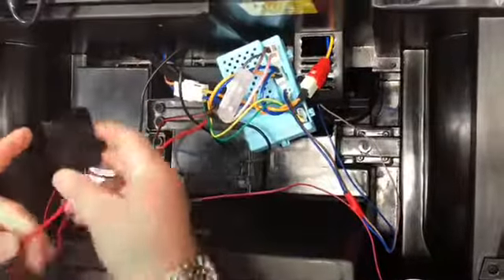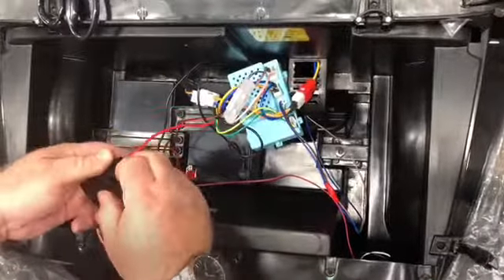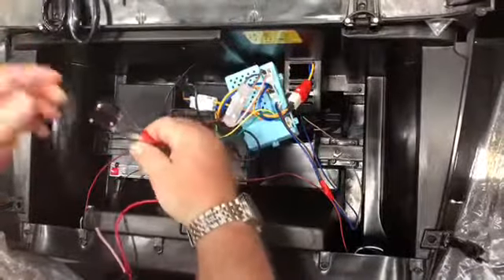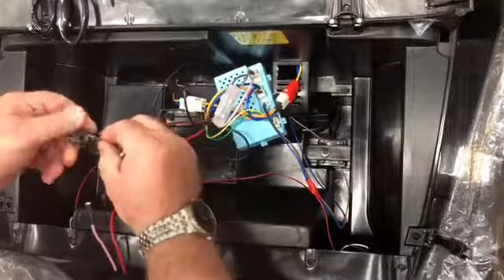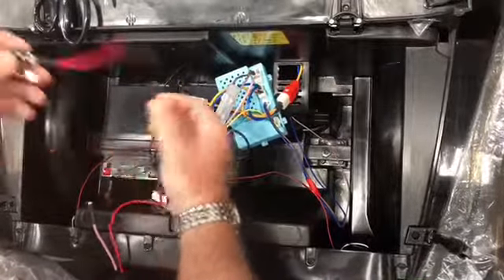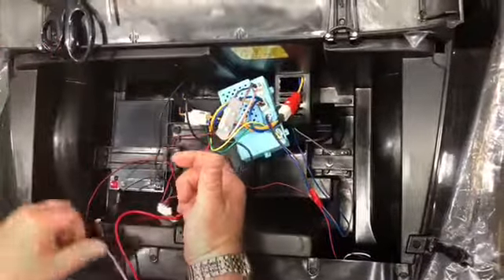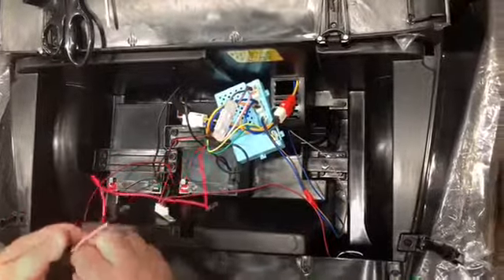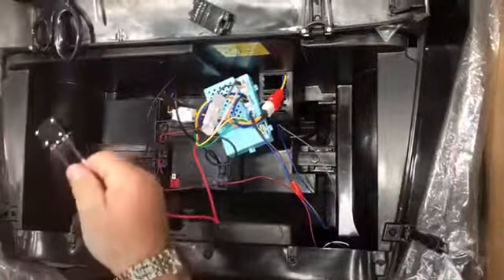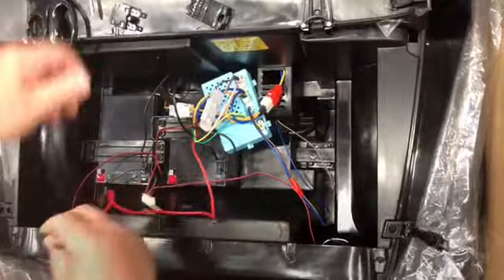At this point, we're going to take the boxes off of the existing circuit breakers and we're going to completely unhook these from the wiring. We'll leave that one hooked — we need the red wire, so we'll leave that one hooked up. Unhook this, remove this box, and remove both leads from this circuit breaker, and set that aside.